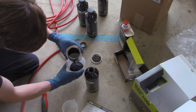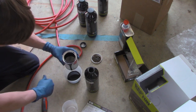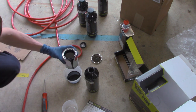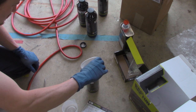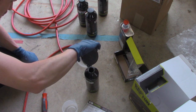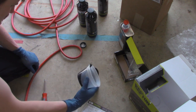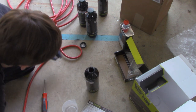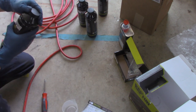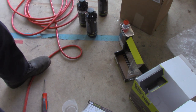In the instructions, Raptor said I needed about 10% paint in there — and this is pure urethane paint, so one pint was more than enough. You take your activator, pour the amount you need into your bottle, add your tintable color, and mix the whole thing together in the bottle. If you're doing a bigger job like a truck bed or frame, you might need to mix it in a bigger vat first and then put it back in the bottle, which is your hopper for the paint gun.